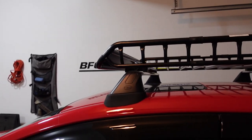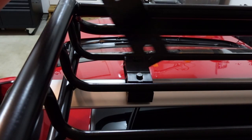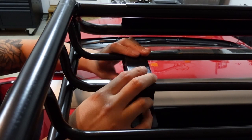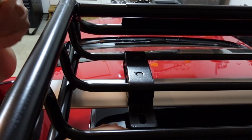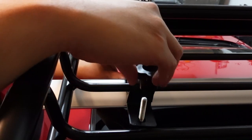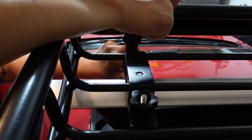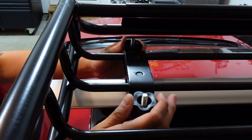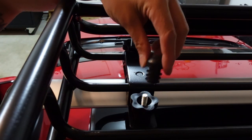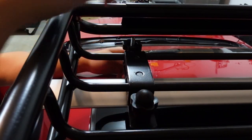I'll show you how to mount it after I move it slightly. Looking from the top view — to secure this thing you need to get the U-bracket, place it above the cargo bars into these little holes, then take the U-bolt and insert it under to secure the actual crossbar. Take the knobs and tighten it down. You want to make sure it's tight enough so it doesn't wobble. Lastly, take these caps and stick them all the way in there to keep water from getting in.